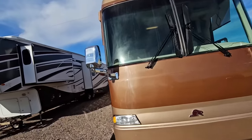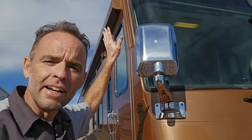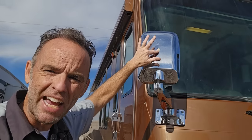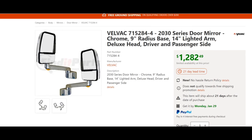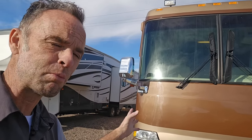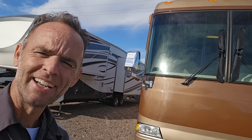When I bought the RV a few years ago, I even noted that the chrome on these mirrors was peeling and it looks bad. The mirror housing is plastic but it is chrome-plated, and that's actual metal on there. Painting this is going to be quite difficult, and replacing an entire mirror for this tiny cosmetic defect seems pretty irresponsible. They're like $1,200 for a replacement mirror because it's chrome. And removing side view mirrors on a motorhome is actually one of my least favorite jobs — the wiring is often too short, you have to cut wires, they foam everything in on the backside of the cap. You can do a lot of damage to the front cap and mirror if you're not careful, so not having to remove a mirror would be my number one desire.